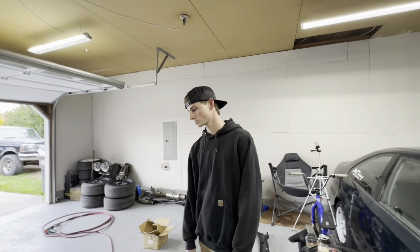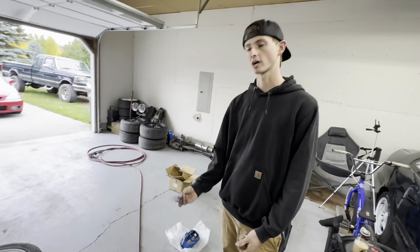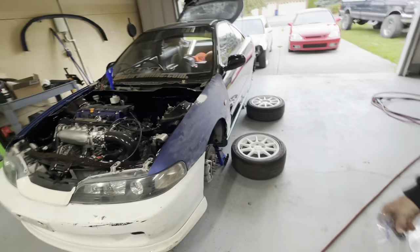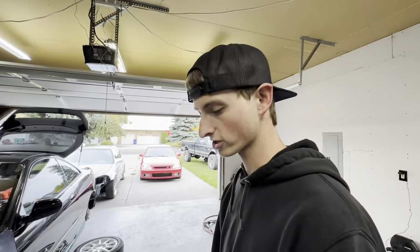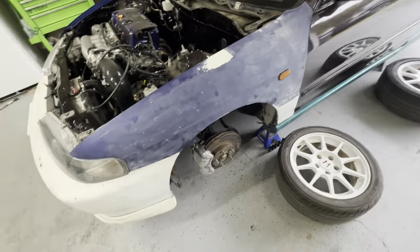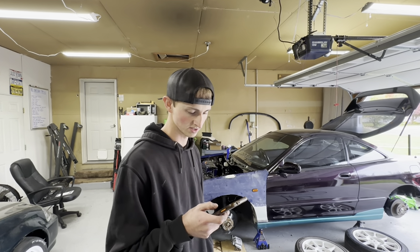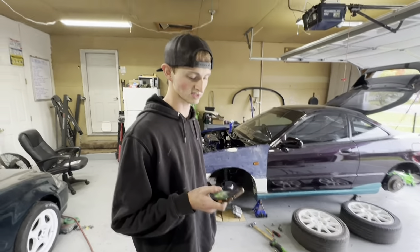There's really nothing more to it — we're just going to jump into it. There's two 17s, one 14 for the brake line, and then the caliper comes off. Cut the dust shield in two spots, install the new caliper with the new bracketry and hardware. That's all there is to it — real simple install. I've got a list of specs and some research to give you guys as much information as possible.